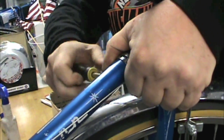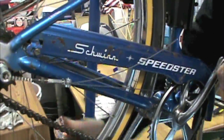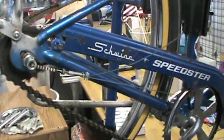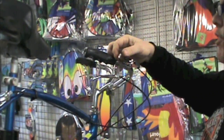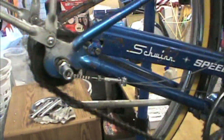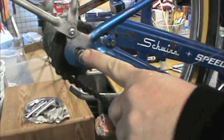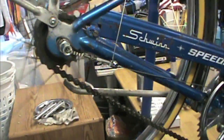Now if we have to fine tune it, we can fine tune our cable tension with the adjusting barrel in or out. Let's test it — there's first gear, and it works. Make sure that it's catching in first. Now we're going to go to number two. Traditionally with a Sturmey Archer, you coast a little bit, give the lever a little flicker, and it comes into second gear. There's second gear, and that works. Make sure you've got enough tension — it wants to catch, it wants to engage. Because if it's in between, this is just going to spin like a windmill and nothing will turn. Now we'll go up to third — flick it in, the whole thing comes in, it catches into gear. And there's third gear.